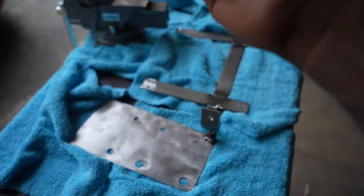The white is the one that goes to the back as well. And we have the yellow and we have the browns. All right, I am at the back here. The first thing I'm going to connect is these two cables, the orange and the pink cable. The pink cable will connect to the red of the pump and the orange cable will connect to the black of the pump. Now, as we do this, I recommend you to remove the negative pole of the battery.